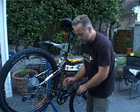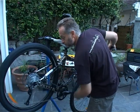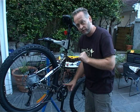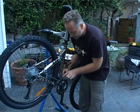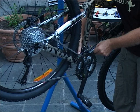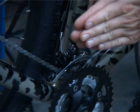Now we have to look at the front gears. The front chain wheel gears are controlled by the front derailleur, which shifts from small to middle to big chain wheel. When adjusting this, it's very important to first shift the gear to the smallest one at the back. The position of the front derailleur is crucial. The front derailleur cage — when you're in the biggest chain wheel at the front and the smallest at the back — should have about a millimeter space between the inside of the cage and the chain. If not, it's going to touch and make noise while riding. That distance can be adjusted by the limit screws.